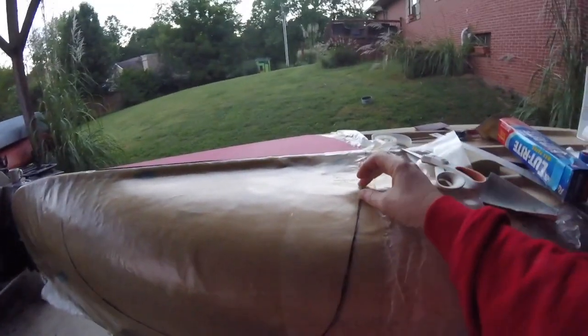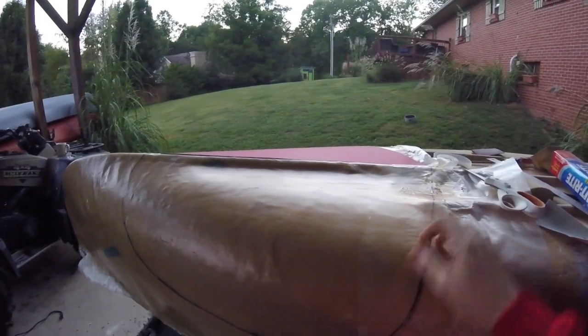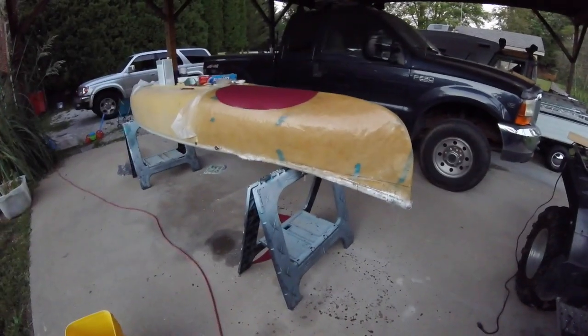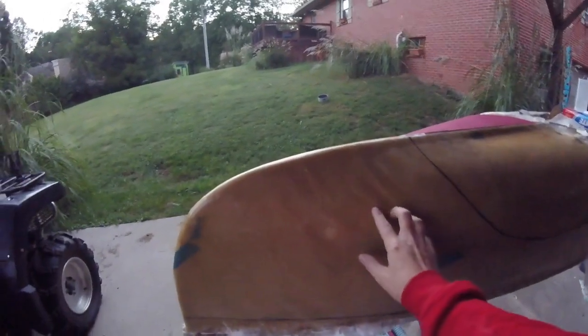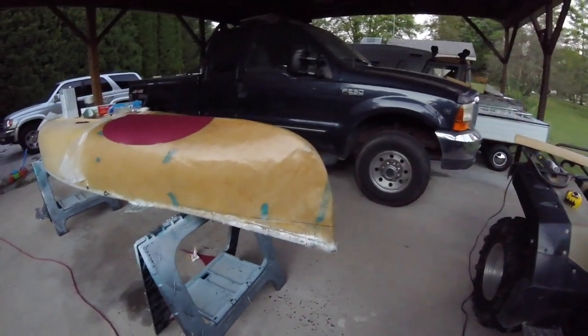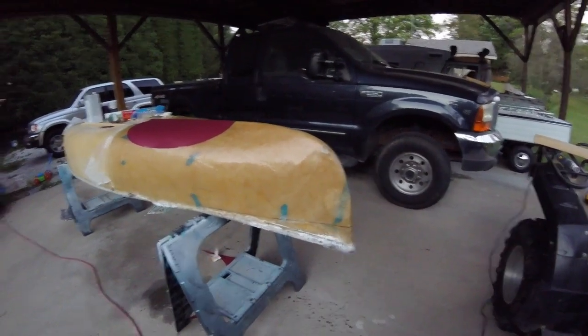This hump that's here and on the other side — I want to bend it in enough to get rid of those. We're probably going to end up cutting out a little bit more of that, or hiding it behind something when I tuck it in. I wish this canoe hadn't had those. If I had it to do over again, I'd definitely recommend the wax paper. But it is what caused this ripple I've got here that I'm going to have to do a little body work on. It actually looks worse than it is — you really can't feel it. The wax paper got bubbled under there and I didn't realize it until the fiberglass had already set up. I'm just going to go with it and putty it — it's going to get painted anyway, so it won't matter.